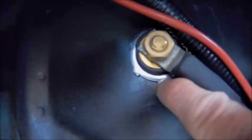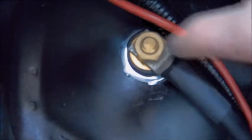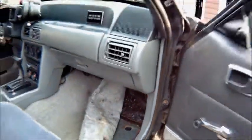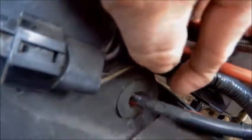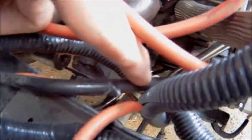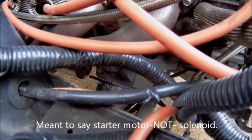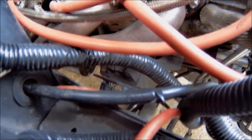Make sure you shrink wrap all your connections. I just drilled a hole in the wheel well area, and on the other side of this connector it looks exactly the same. The cable goes through, it bolts onto the other side and goes to the starter from there. You can't see the other side of this from outside the car because the plastic wheel liner covers it up. We'll go into the engine compartment now. You can see right here I have it routed through the shock tower. I put a grommet on there so the cable doesn't rub on the metal and short it out. And then this cable just runs down to the starter. If you have a standard starter on your car, this is the setup that you're going to have. So that's the basics of the starting circuit. The next thing I'm going to cover is the charging circuit.